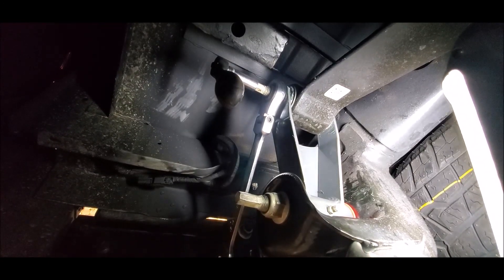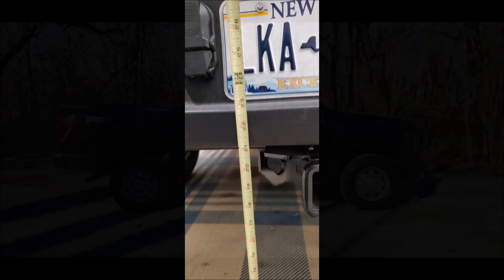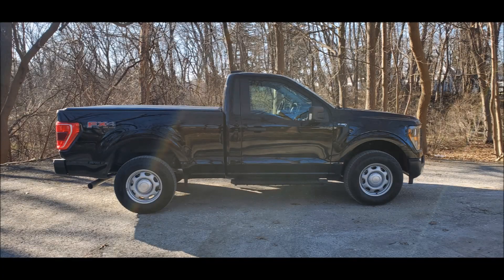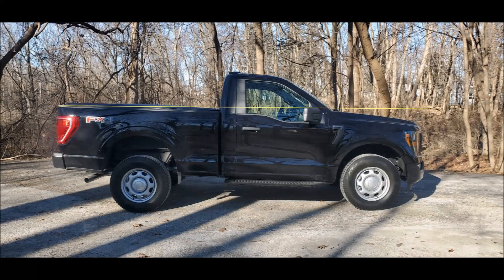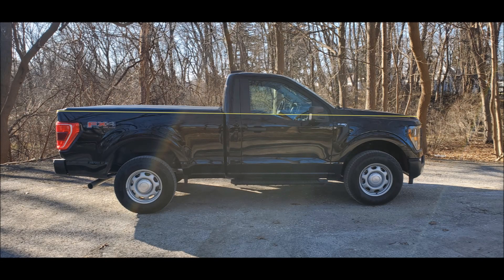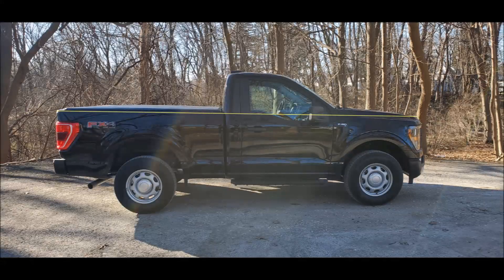Let's get this done. Here's a great comparison — the bumper before was at 24 inches, and the ride height is now just below 23 inches, and that's before I even bounced on the bumper or took the truck for a ride to let everything settle. With only 100 miles on the truck everything's still going to settle. After the kit it's much more level — doing a line comparison you can see the nose had to pivot up as the rear end went down, so it's noticeably more level now. I'm happy with it. Next up we're moving on to the exhaust, a cold air kit, and some wheels and tires, so stay tuned.